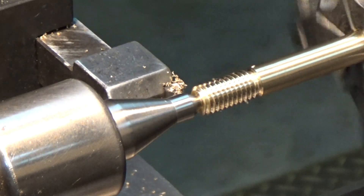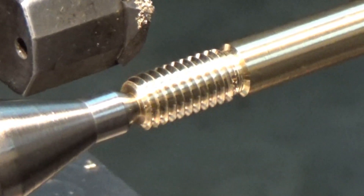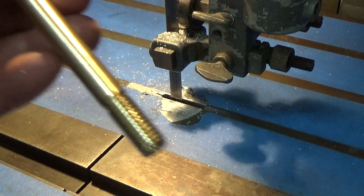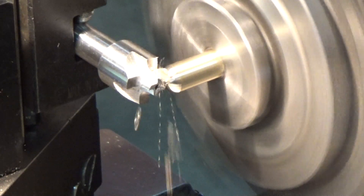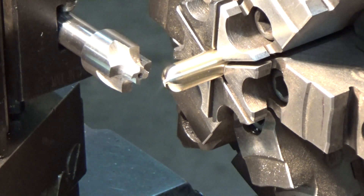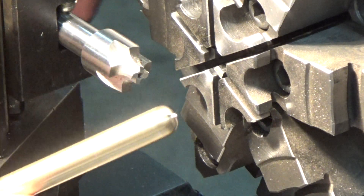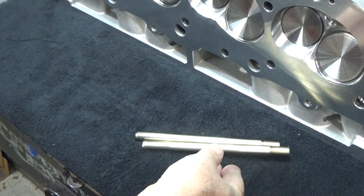Getting to the final cuts — perfect, looks nice. I'll go ahead and cut it off. Since I want it to guide the head on there, I want to round that end. This is actually a mill for my milling machine to cut round surfaces around corners, but I can chuck it in my lathe and do the same thing. Our end there is now nice and rounded.